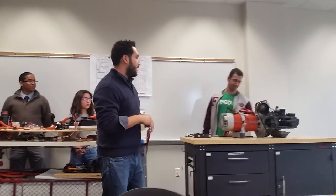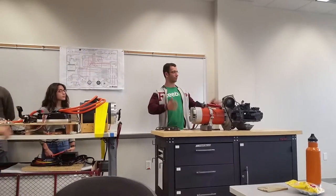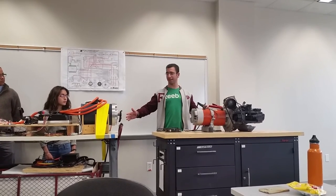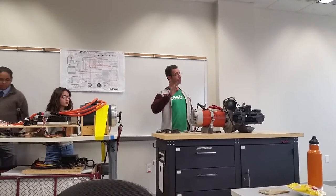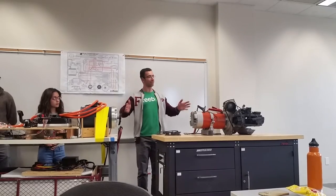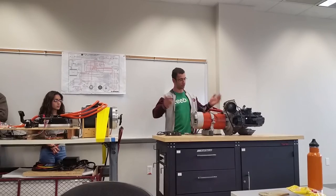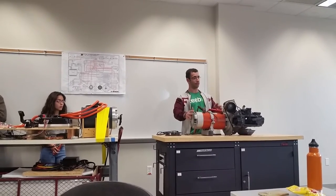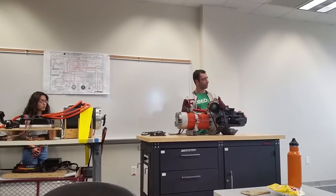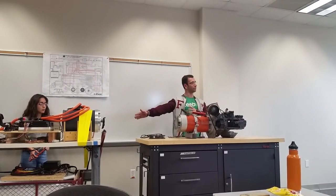A more primitive example — Kaz has an adapter plate, and he'll explain it. You can think of this as old technology and this as new technology — tractor technology versus Tesla technology — but essentially it's the same. All you need to make any car electric is three main components: the electric motor, a speed controller, and a whole bunch of batteries. That's what an electric car actually is. What we have here is a DC electric motor — a standard 8-inch electric motor — with our adapter plate in the middle connecting it to our transmission. The transmission doesn't even know it's not running gasoline.